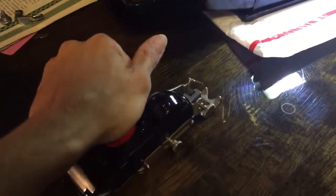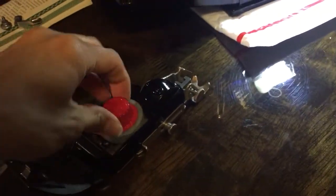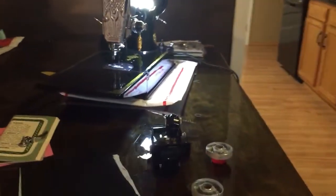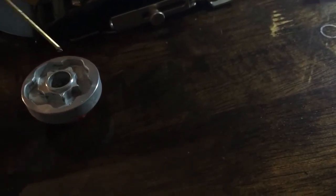This is the zig-zagger attachment, and these little cams fit inside of here. If we look on the cam you can see that there are two little notches. These cams — you want to put a drop of oil inside of there. I'm going to grab another cam out of my box because I've already put a drop of oil in that one. You just stick a drop of oil right inside of the cam on the outer portion, not in the hole but on the outer portion.